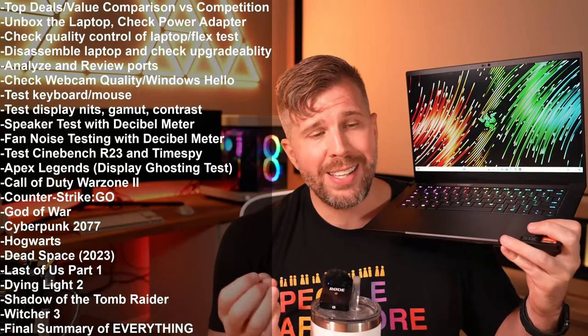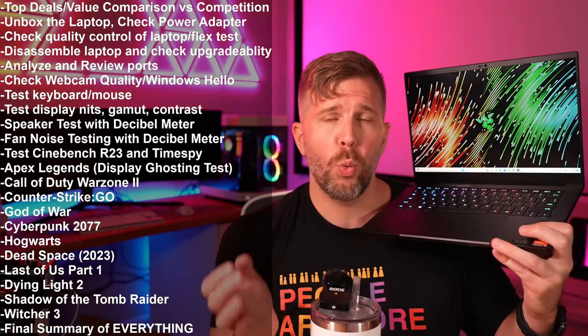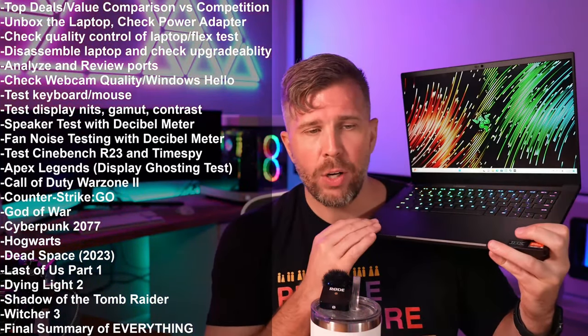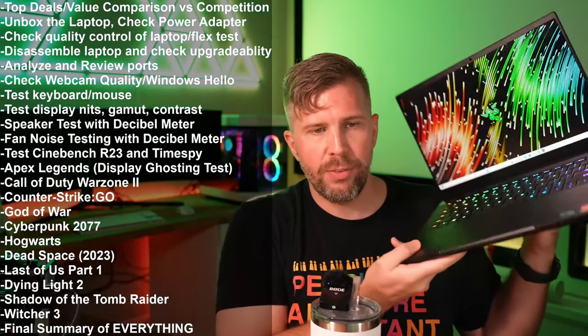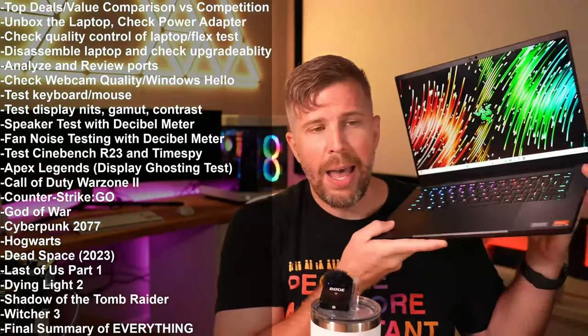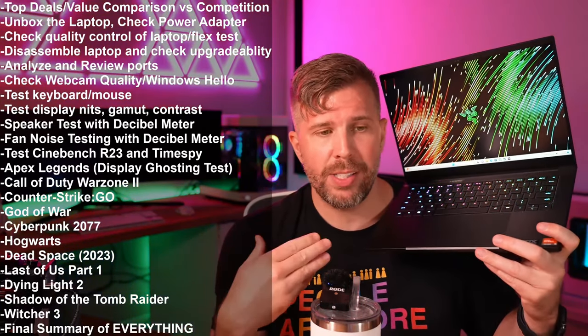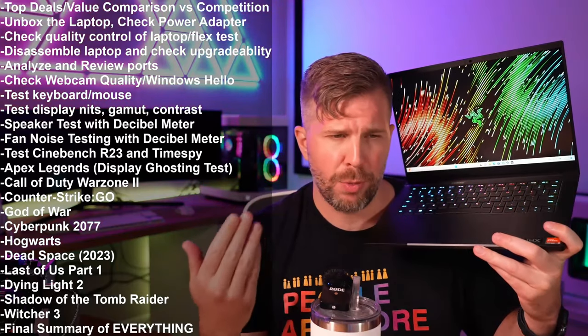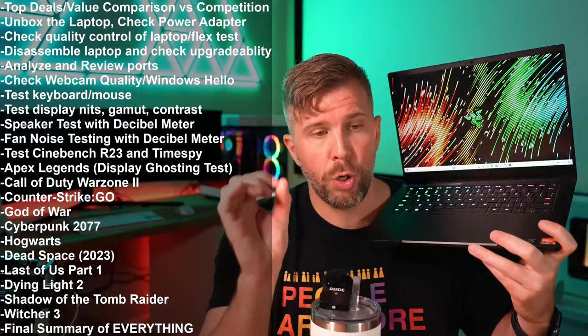Cinebench R23, 17,048 for our Cinebench R23 score was excellent. For an 8-core, super thin, light laptop like this, this thing is as portable as a 14-inch laptop can pretty much be, and it still pushed 84 watts of power to the CPU, and it continuously improved its performance during the 10-minute run, which was weird, though it got closer and closer to thermal throttling.